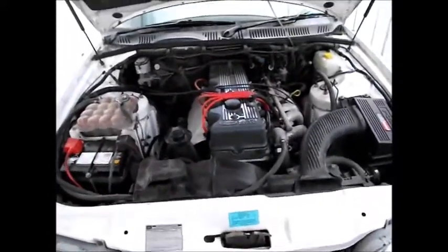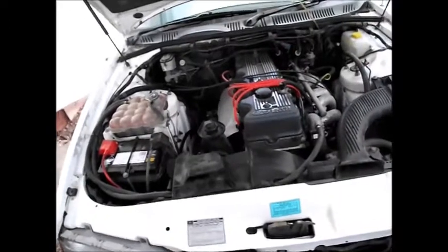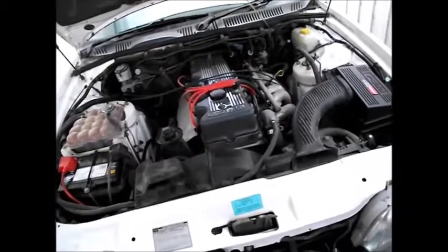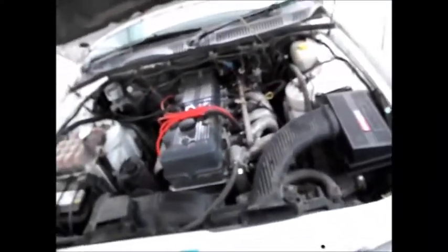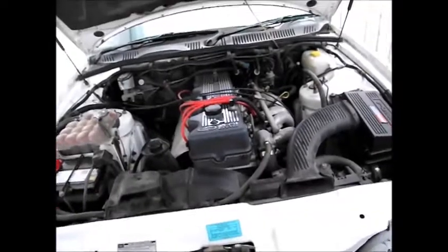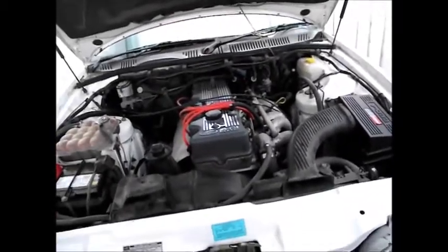In this type of system, it's not like a car 30 years ago that just had the cap and the overflow. If you're putting water in it regularly, I reckon you should be able to top it up with maybe 600ml of water every month or two months. When I've had cars in good condition and the cooling system works properly, they don't need topping up. If you're having to put litres of water in, it means you've got a leak basically. Also, if you do run coolant, that will show up a leak pretty quick because the coolant will stay green — any leaks in the radiator core or around the block, because the water evaporates but the coolant itself will be left behind.